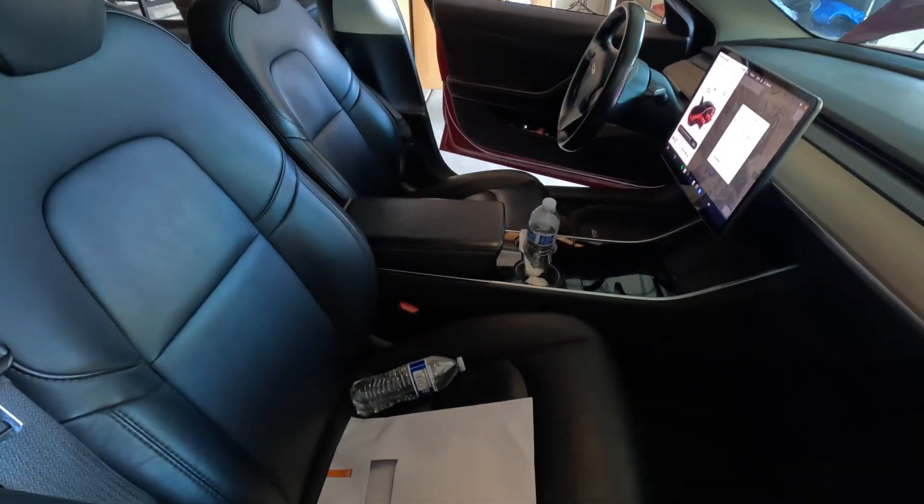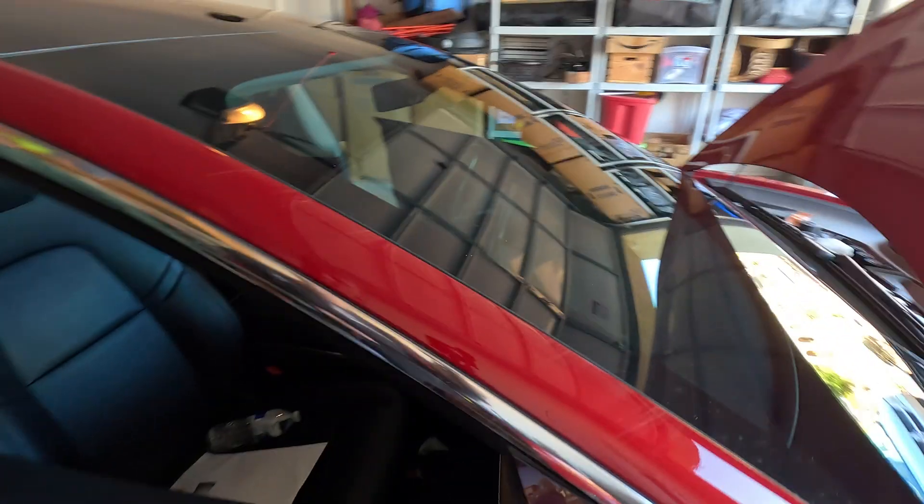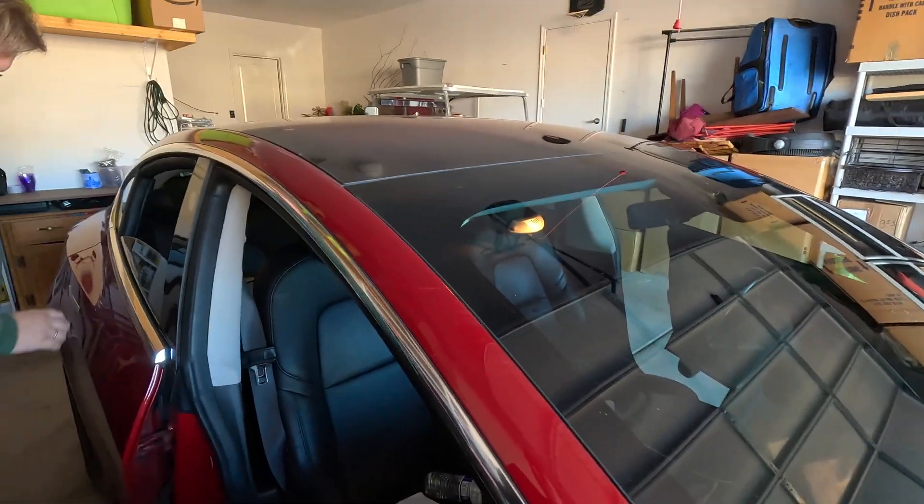Oscar is a little sick, but that's what we have to do. Doors open — so that we can get back in the car, because when the 12V battery is down you can't open the rear doors. You can open the front doors because there's an emergency mechanism for that. The windows need to be down because if you open the front door, you could rip them out — that's the problem.